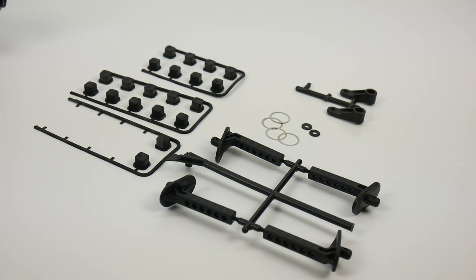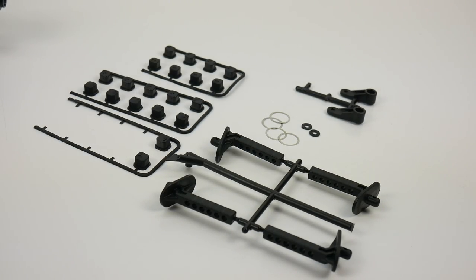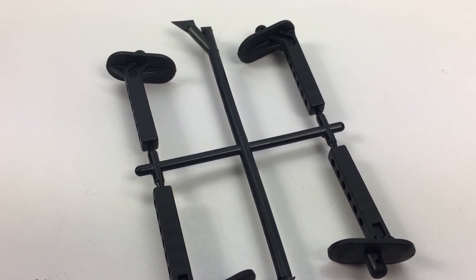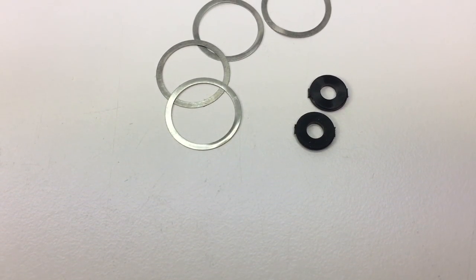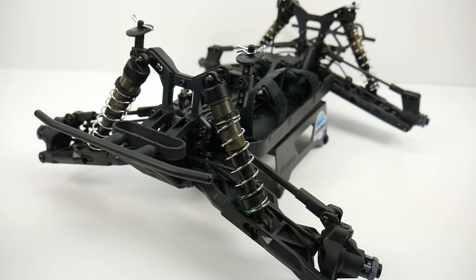What's left over in the kit includes several different options for pills for the suspension arm holders to get different geometries. You have additional body posts for a different offset, or to bypass certain parts of a body. There are four additional diff shims, though my diffs fit absolutely perfect. A couple of extra spacers for wheelbase geometry, and a couple of extra servo horns — I installed the 25 tooth. Overall the kit went together absolutely great.